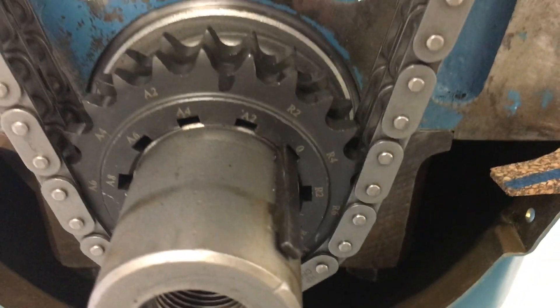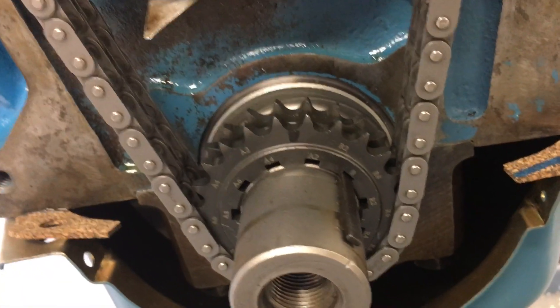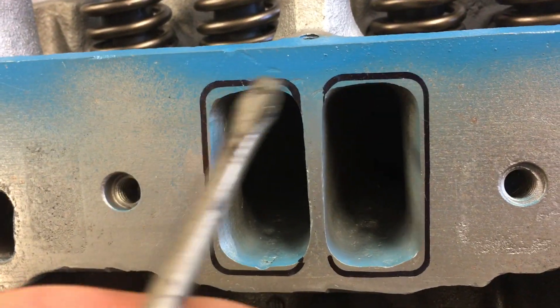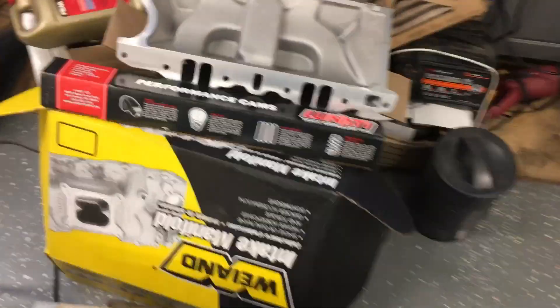It has all the adjustments for different advances and retards — mine's just on zero. I remarked that gear again; I may try to advance it one day. I know these heads are kind of restrictive. I got them marked after I ported them — I didn't bring the ports all the way out, just trying to keep up the velocity a little bit. I'm using the Weiand intake here — they recommend these gaskets, that's what I got. I switched intakes in the middle of the build; it's a dual plane, which is nice and probably what I need, and it's what my cam recommends.